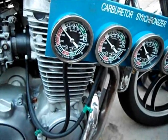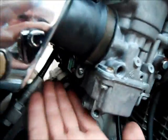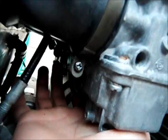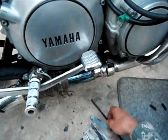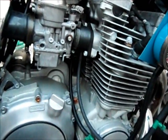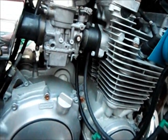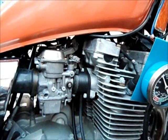Really other than that, you've got your air fuel mixture screws — mine are right here as shown in some of the pictures. Kind of hard to see there, but on the other side is the choke, and up under here is your air fuel mixture screw. Just keep it at about 1,000 RPM — that's what the book says to run these at. But that's pretty much it. If you have any questions, subscribe, like the video — whatever you can do. Thanks.